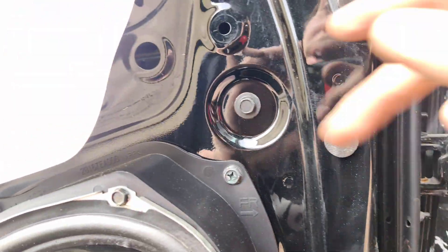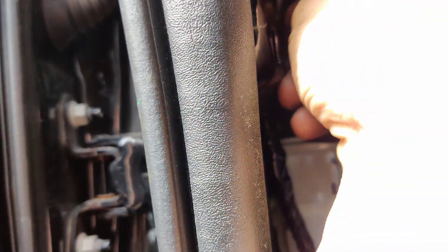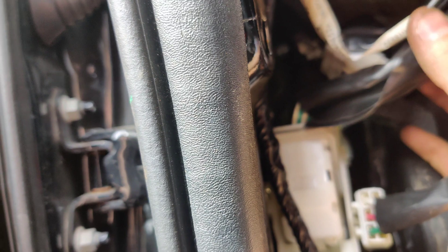I'm back with the Nissan. They had me come back to look at this. We had an open going to the door and also the front - both of them are open. I'm wondering if they mixed these connectors up, because we've got black and white up here and gray. I think black and white went to the front, and then there was a red.